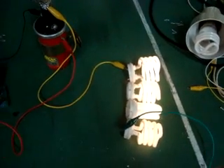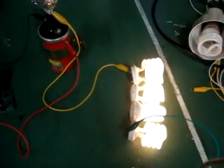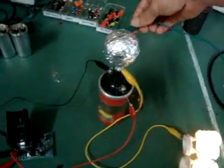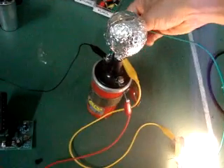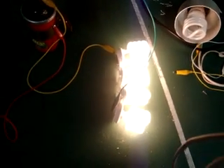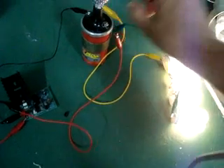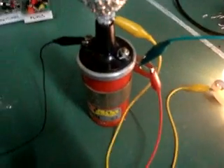If I just connect the other side to my ground I get better results, though it does seem to bring the amp draw up a bit. The best result I've found — I know Emo Teep's version — he connects the other side of the high voltage line coming off the CFLs to the negative. But I've found it's even better and there's less amp draw when I hook it up to the positive side. So the high voltage line goes through the CFLs and the other side runs back to the positive of the ignition coil, before it hits that diode.